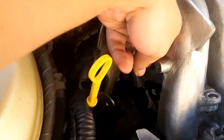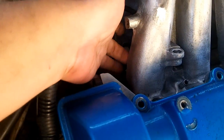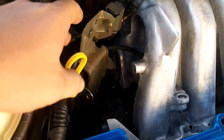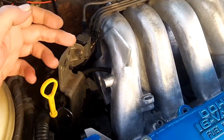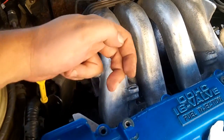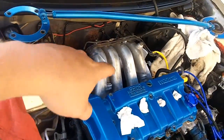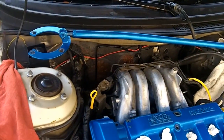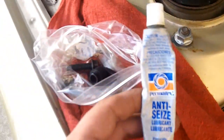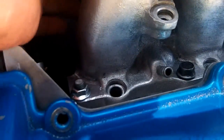Got my vacuum tube hooked up. This vacuum tube right here gets plugged in right below here — there's a little vacuum port. Over the life of the car, the rubber hoses have a tendency to form into curves, so you can kind of follow where the curves go, which makes it a lot easier. It's not a bad idea to use some anti-seize when you're putting all that back in. There are two bolts on the top and three bolts on the bottom.